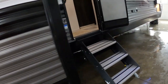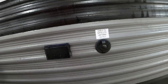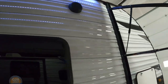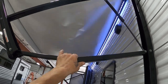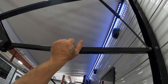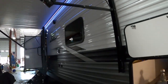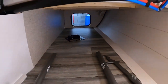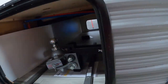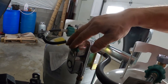Coming over here on the campsite side — you are prepped for a TV. There's a clamp in there to snap onto your TV; it clamps on here with a 110 outlet and cable connection. There are also a couple of outdoor speakers. Your awning has pitch adjustments — if it's raining, you can pull down on this to tilt the awning to shed water. Awnings are for shade. In light rain, heavy rain, or high winds, bring them in. Up front, your propane has a cover and runs on a regulator — make sure it's pointed toward the tank you wish to be using.